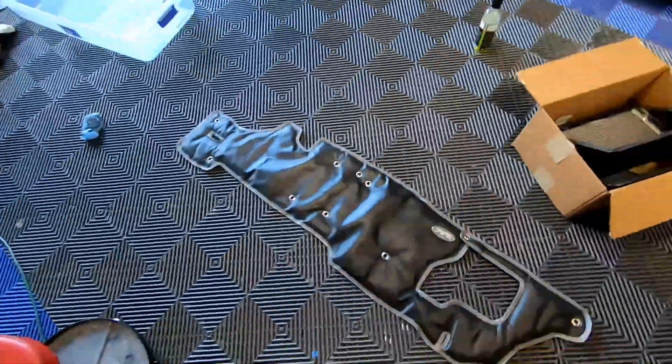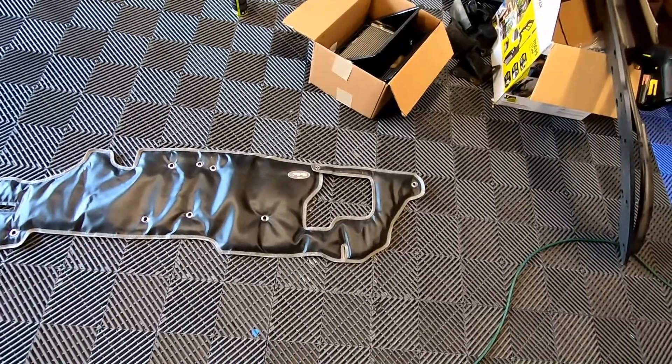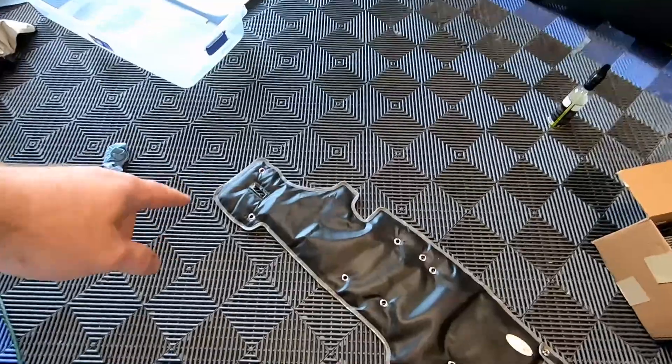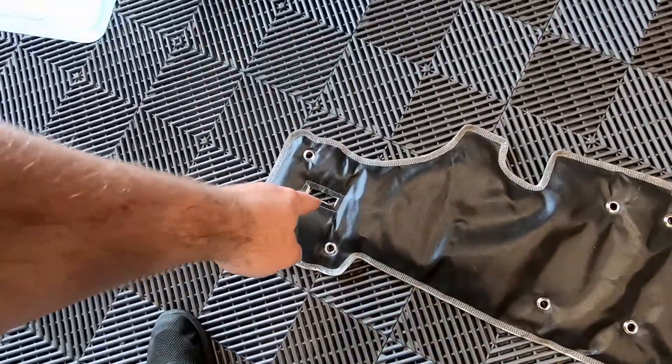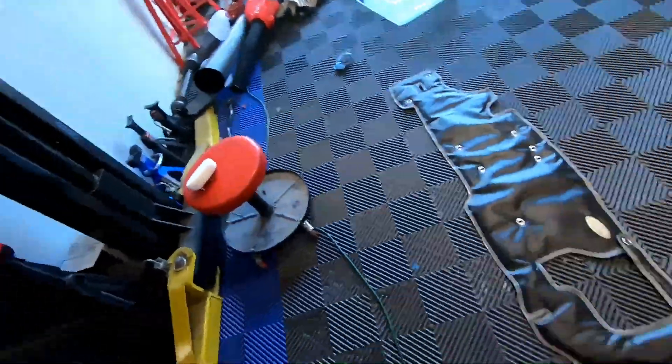It's a woven product, not like a fabric that can be easily cut or damaged. Hopefully this goes pretty smoothly. There are a couple of pain points — one being the air conditioner. I do have full HVAC in the truck, and this rectangular cut-out section over on the left — we're basically going to have to take the AC accumulator bracket off the firewall, pull it back, and then put it back on. That's going to be the biggest pain.